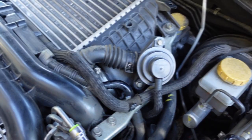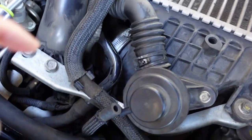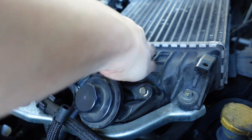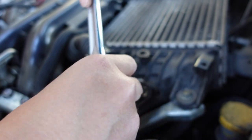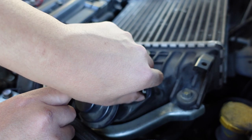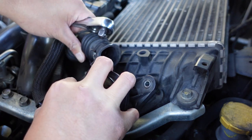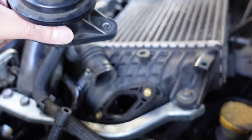I'm not going to get into the settings for now — I just want to get it installed and see how it sounds. The first thing is to remove this tube right here, then there's this retaining clip right here. Then you've got these two 10-millimeter bolts right here — pop those off — and that should do it. That was easy. Quick stock to aftermarket comparison.